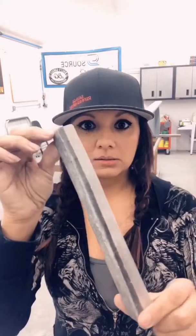These are probably my favorite kind of blocks. They still have the combination of the acrylic, but a nice little squishy pad on the back to help get just those nice round corners when you're finished sanding. They're like this. So there's the acrylic, and then there's the squishy. It's not too bad, but it still has the acrylic on the top, so you can't bend it. So it still sands really straight. It helps with when you're doing dashes and wet sanding and stuff like that. It gives it just enough softness so the edge doesn't cut into the paint, and still gets nice and straight, easy, quick. They come in lots of different sizes. I love these little ones. Look how small they are. Little pads, they're perfect.